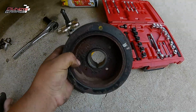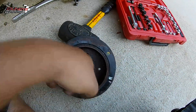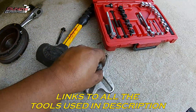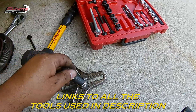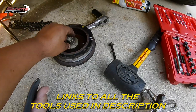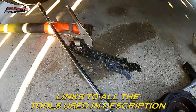There's the pulley kit I used, and the mallet. You need a 22mm socket for the crankshaft pulley bolt — it is not reverse threaded, it is normal. Righty tighty, lefty loosey on that bad boy. There's the little piece of belt I used to not damage the crankshaft pulley, and you'll need a chain vice grip as well. I'll put how many inches of chain I had on that vice grip chain wrench in the description. I actually added more chain when I first got it to tackle bigger jobs.